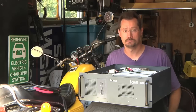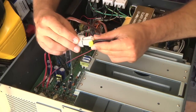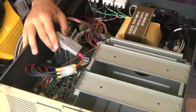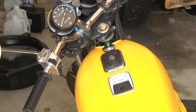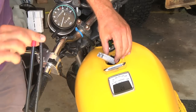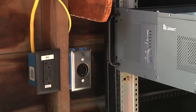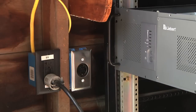Let's take a quick look at what I actually have to do to make all that happen. Normally this would be mounted in the equipment rack, so the pigtail and connector would already be together, and I basically permanently leave this extension cord connected. Normally I would park the motorcycle, pull out the charging plug, and then hanging on the wall I'd have the cord that goes to the UPS — it's marked positive and negative and it's keyed so I can't accidentally plug it in backwards. Just plug it in like that.